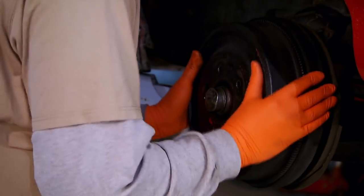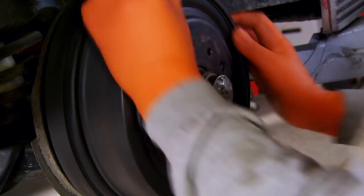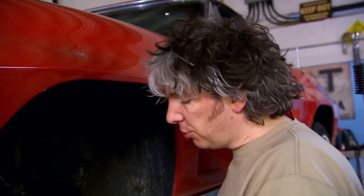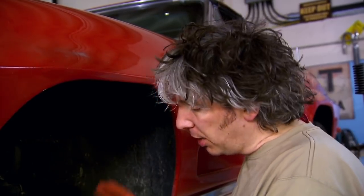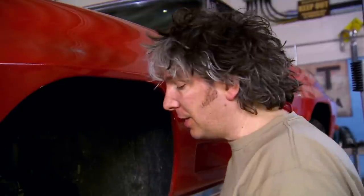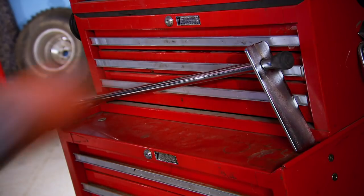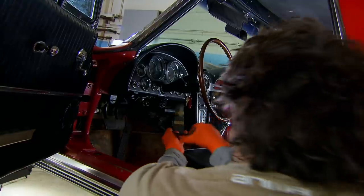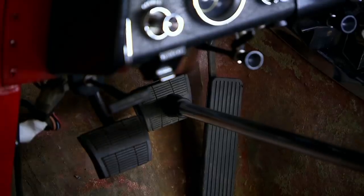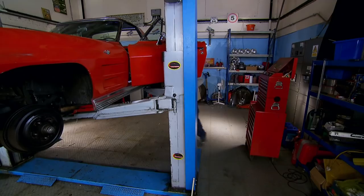The effective braking force can be adjusted so both sides are evenly matched — that way neither brake will snatch and pull the car to one side. I've got the shoes on both sides just lightly touching the drums. I'll pump the brakes a few times to centre those shoes, then use a nifty tool to apply a constant pressure to the brake pedal so the shoes are lightly rubbing on the drum, and I can feel whether the resistance on either side is the same.